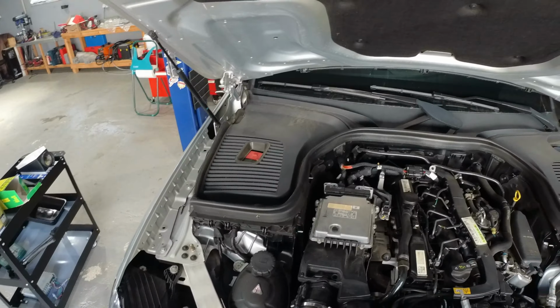To have access to the drain bolt, you need to remove the oil pan cover, and you have 4 M13 bolts that you need to undo, and you have 4 more in the front. This guy is heavy, but it will swing down and it will be held in here. You can take it. You have now here the drain bolt. It's also an M13 that you just need to undo. And now you just let it drain.